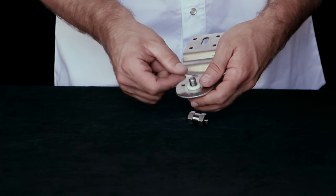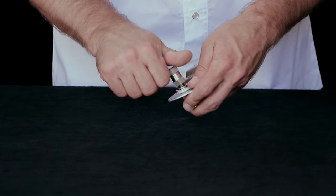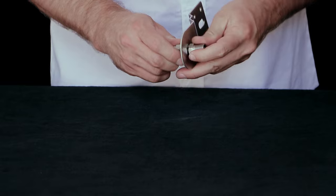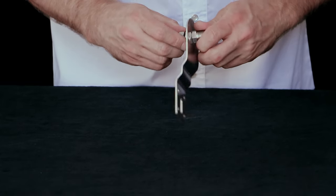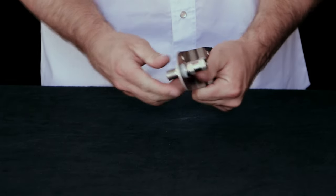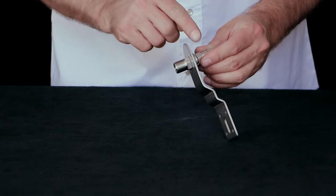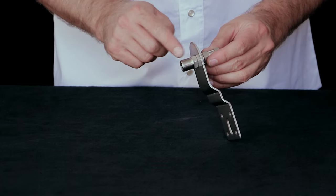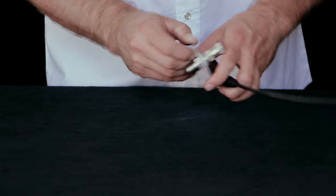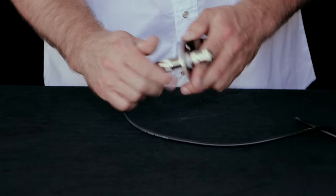That's also a half inch hole. Then next would be your flat washer, then your lock washer, and then your double sided nut. Thread all these together, making sure that the lip on that nylon washer is seated down into the mounting hole. If you had added any washers on the underside, you'd create a connection between that center portion of the antenna stud and the mount and would ground it out. So it's extremely important that everything's in the right position. Once it's all done, you just take your PL259 coax cable, put the center pin in the bottom, and thread it on.